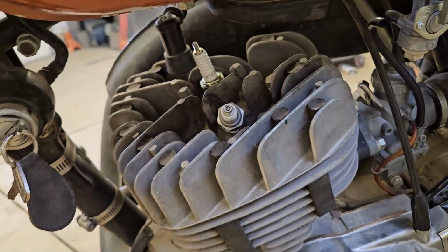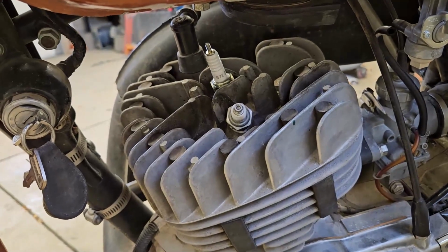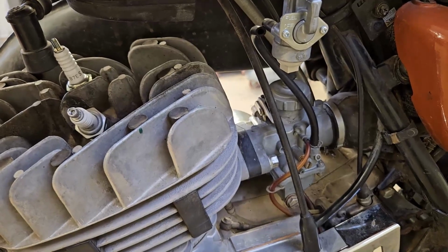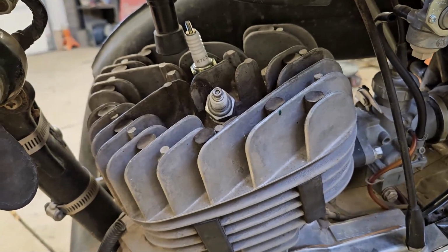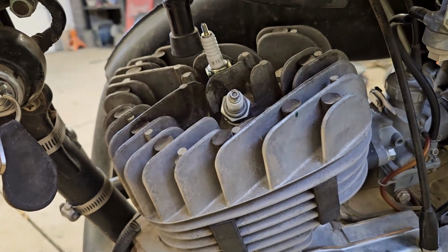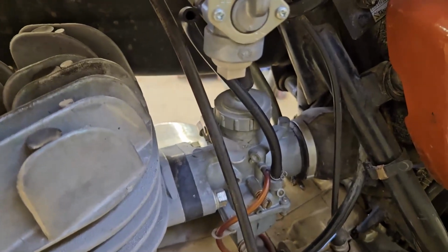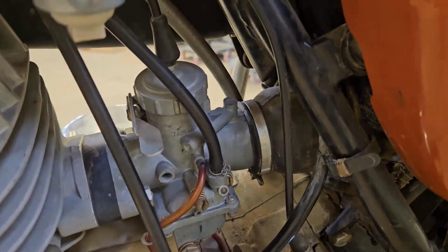And now this bike's been sitting for 30 years. He says he hasn't started this thing. He did put oil in the cylinder. He kicked it over. This was his baby, brand new. So I'm going to have to see what I've got in the cylinder walls, which I can tell you right now, I already have. I've taken my endoscope and I went in. There's the typical carbon buildup on the top of the piston, but where it's flaked off, it shows a silvery piston. The sidewalls don't have a whole lot of scratching, and there's still evidence of the crosshatch.